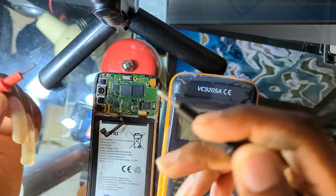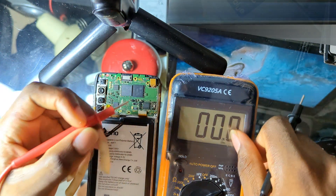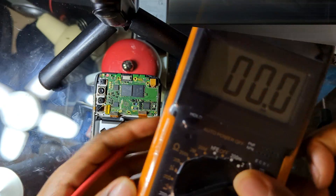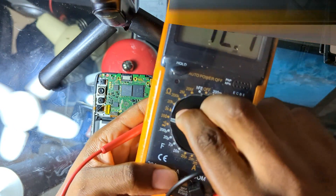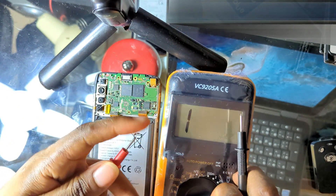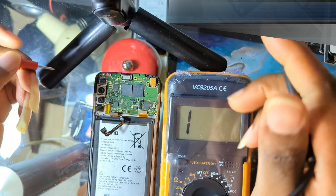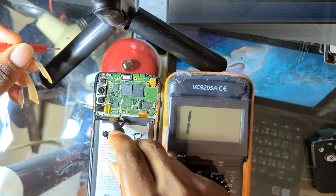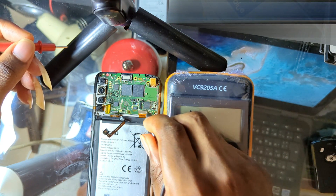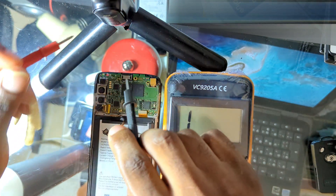If your battery is confirmed good, the next thing to check is whether there is any shorting — full shorting or half shorting. To check this, set your multimeter to buzzer/diode mode. When you hear the beep, disconnect your battery from the phone. Make sure there is no voltage entering your phone — we are doing cold testing, and when performing cold testing on a mobile PCB, the PCB must have no voltage.